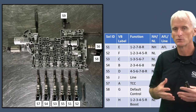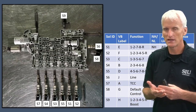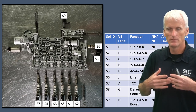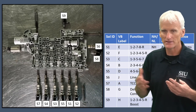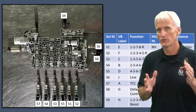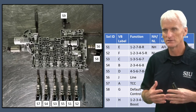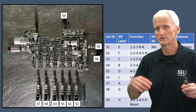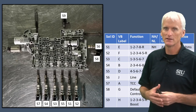If we have a unit on the bench, we're limited in what we can check — we can check resistance. In the vehicle, we can look at scan data and verify desired and actual amperages for each solenoid. On a bench, we can check resistance, energize it, pump air through the valves, and make sure it passes and traps. But that doesn't do a thorough job because with these things being pulse-width modulated, they don't just pass and trap fluid — they have to control it properly. Without sophisticated equipment, we can only do rudimentary tests.